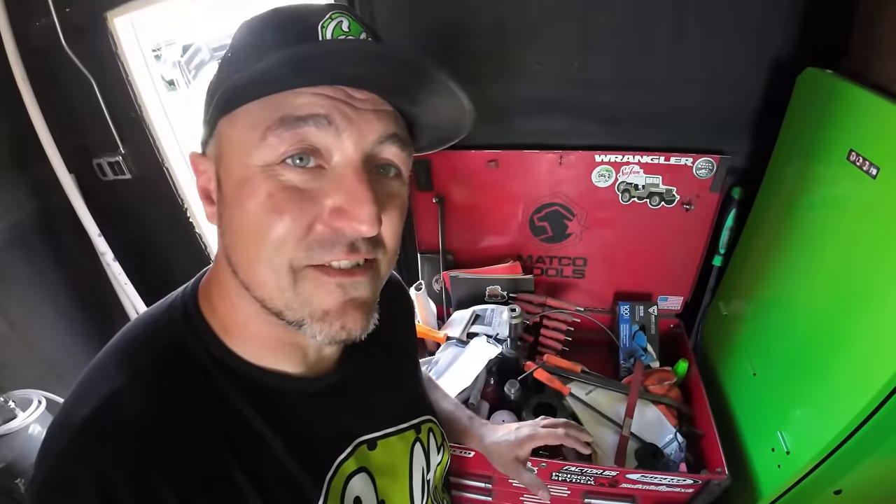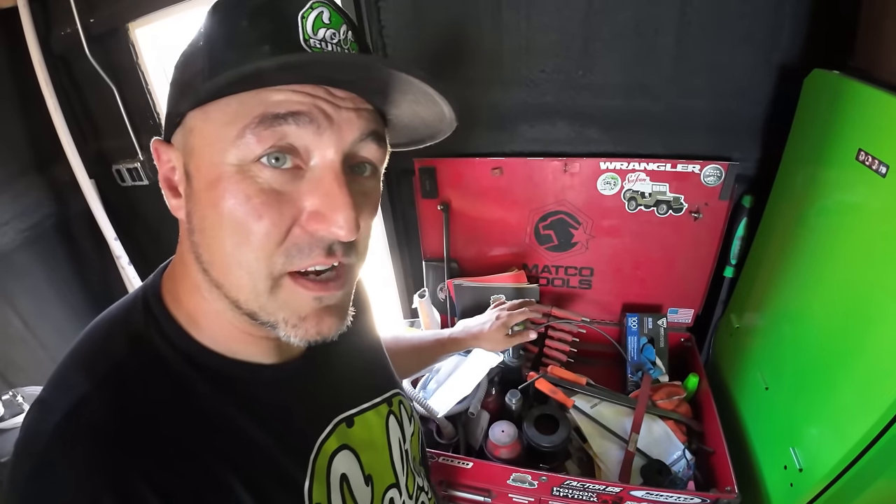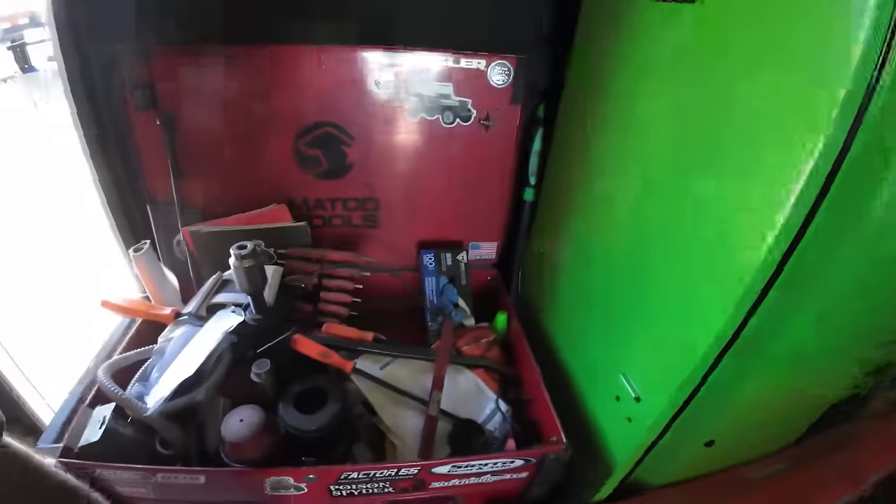I've been scratching my head on the affordable way to get gears in this thing to actually gear it down. You could gear the axles — gears aren't very expensive — but when you do gears you want to do lockers too, and then you need a lot of tooling. The biggest thing about gears is having the tooling and knowledge. My toolbox here is set up just for gears: pinion bearing puller, pry bars, air hammers, clips, seal pullers, race drivers, calipers, micrometers, dial indicators — a lot of things. Even though gears are affordable, the tooling and knowledge take up the time and budget.